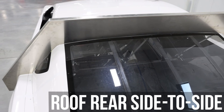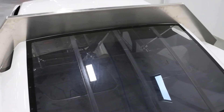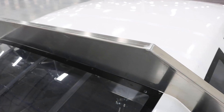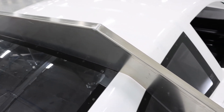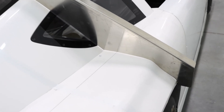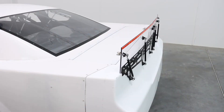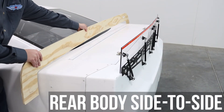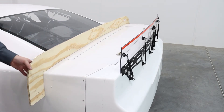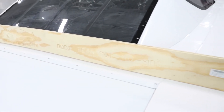The roof rear side-to-side template is located at the top corners of the rear window at a 90-degree angle to the roof. It extends down the quarter panel, across the window, over the top of the quarter panel, and down to the wheel opening. This template controls the side-to-side shape of the rear of the roof, the shape of the greenhouse at the quarter panel window, the correct rear width of the doors, and the shape of the top of the quarter panels. The optional rear body template works with the center line template to maintain the proper shape of the deck lid as well as the shape at the top of the quarter panels. It is centered between the window and the deck lid hold-down recess.